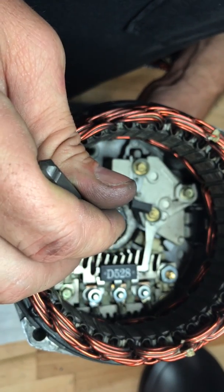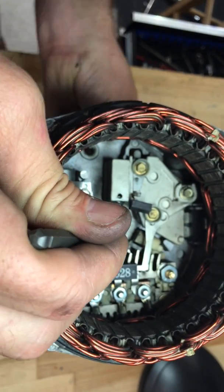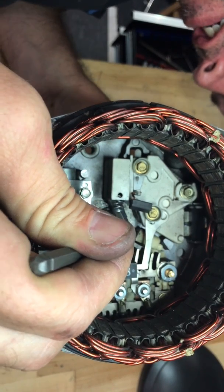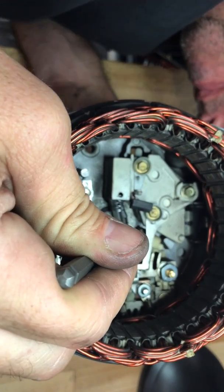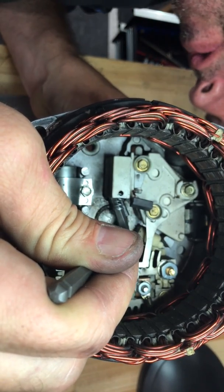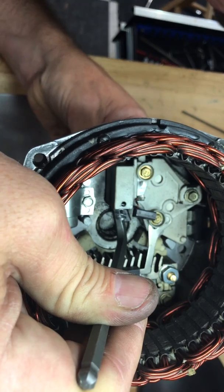It's simple — you've got to fight the springs and the brushes. The simplest way I've come up with is you can slide an allen key in from the bottom through the spring holder, or the spring and brush holder. You've got to get it lined up first.